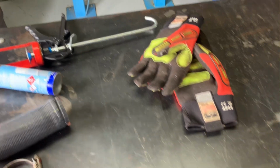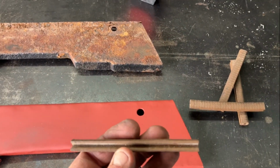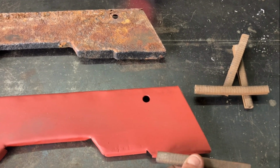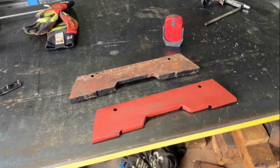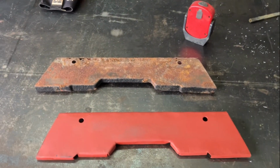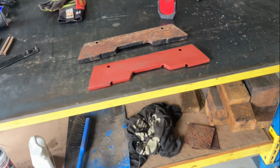And then I've got some of this, I can't think of what you call this stuff. Clip lock or hammer weld or something, whatever they call it. I'll put that along those edges. That way it won't rub through the bottom of the tank. Not that the tank should move, but on a petrol tank you don't want metal on metal where possible. And obviously flexibility in the lines.